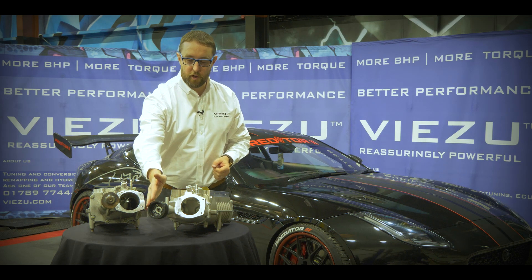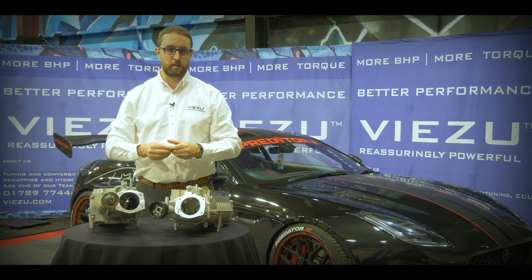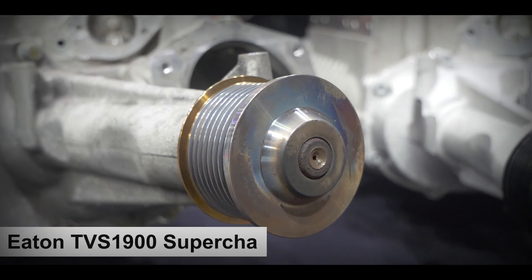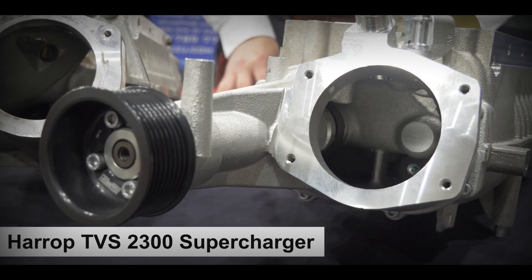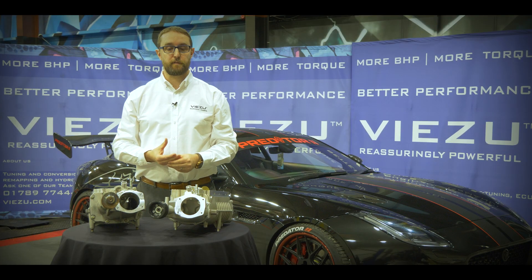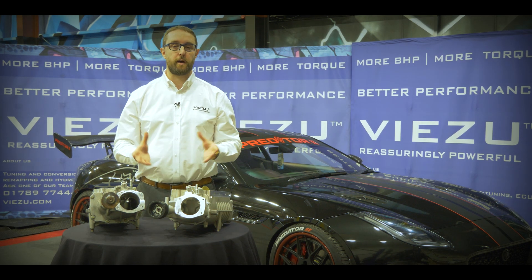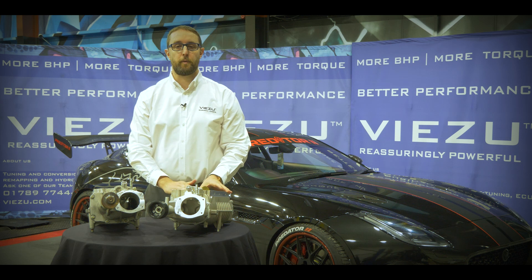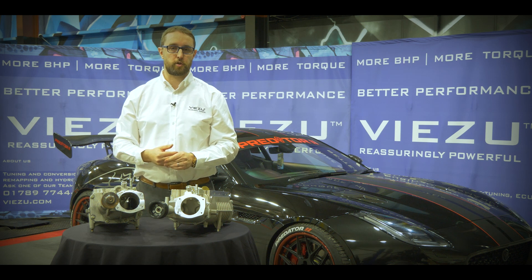Finally, moving to the very front of the Supercharger, we can see the pulley — a slightly different design. This is actually a bolted-on pulley, as opposed to the interference heat-fitted pulley on the standard Superchargers. We've opted for the 70mm pulley here, which is smaller than the approximately 80mm factory pulley on the standard Eaton 1900 charger found on your 5.0L Jaguar. By combining this 70mm pulley with this Supercharger, it still remains a bolt-on fit — a direct replacement for the vehicle. With no other modifications needed, you can fit the Harrop TVS 2300 straight to the car, with all standard cooling and fittings retained.